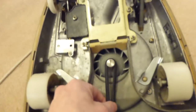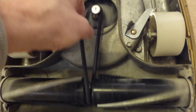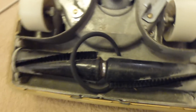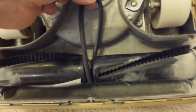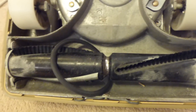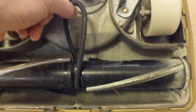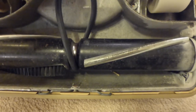So what I'm going to do, I'm going to take this back off, because when you've got upright cleaners, the best thing you can do when you're going to store them away for a long time is just whip the belt off. I know it's a little bit of a hassle when you want to get them out, because you've got to keep putting the belts back on, but if you store a machine with that belt on all the time, you'll have a collection of 30, 40, 50, 60, 100 odd machines, uprights, all with the belts on. Next time you come to use them, the belts will keep slipping. That is the big drawback with upright cleaners. With cylinders, you're okay because they don't have drive belts, but I would always advise, if you're going to have an upright and you're going to keep it in storage, just whip the belt off. Then you can put your base plate back on.